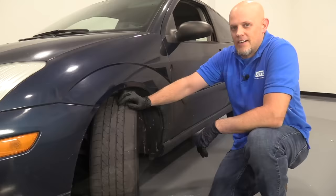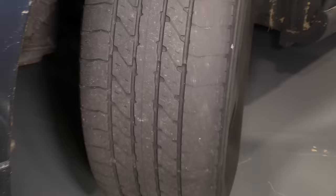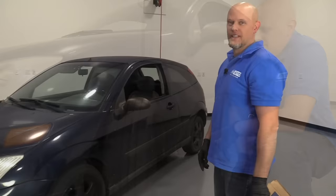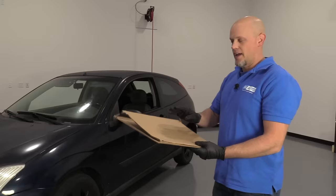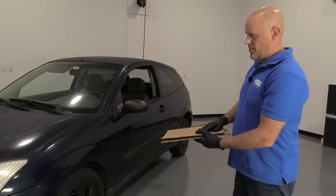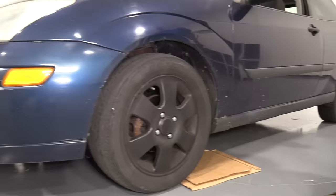We're checking out this vehicle and we found the outside edge of the driver's tire is excessively worn. The alignment on this vehicle is off a little bit, so we're going to see if we can adjust it to improve it. Before we start, you're going to want to make sure you're on a flat level surface, make sure all your tire pressures are accurate, and I'm going to take two pieces of cardboard per side so the front tires can sit on them and swivel back and forth a little bit easier.